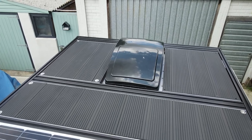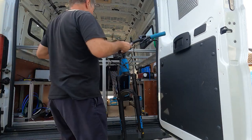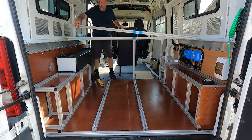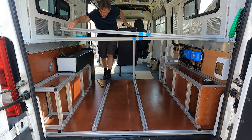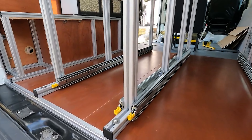After completing the roof rack, we turned our attention to creating a raised bed above a garage large enough to house our two e-bikes. Four pieces of 40x40 extrusions spanned the van and easily fixed to two pieces of angled ally that gave us our designed height for the bed. This alone would have been enough to provide adequate support for a bed, and where we could have made quite a saving had we not wanted to support two heavy duty slide-out trays.